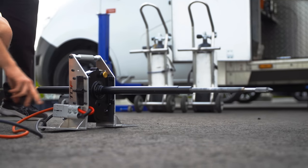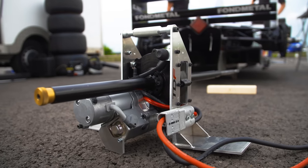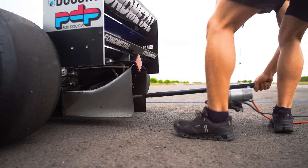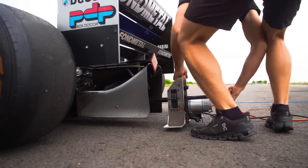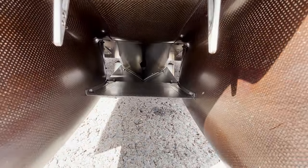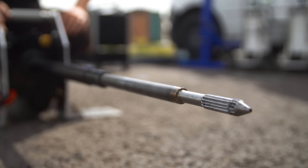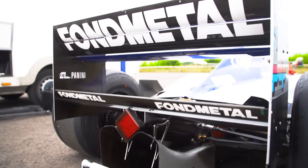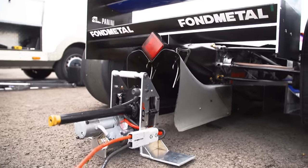The final part of the fire-up is the starter. We use an external starter — it's a weight-saving measure and more efficient for what we need on circuit. We have a battery pack and a large off-board starter that goes into the gearbox, connecting straight through via the lower shaft into the crank. The starter has a splined shaft that matches something inside the gearbox, which turns the lower shaft and in turn the crankshaft — just as you would in a road car, except we're doing it all externally.